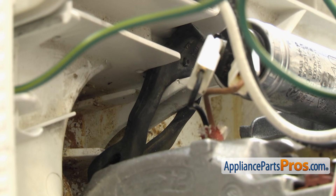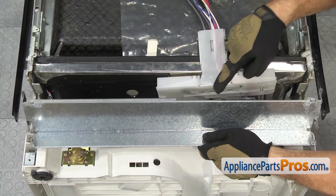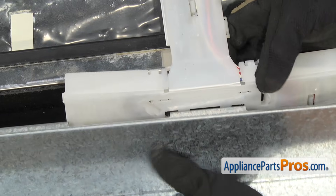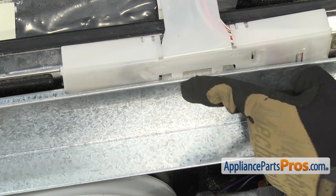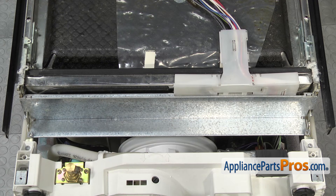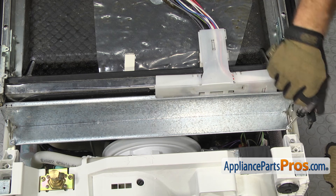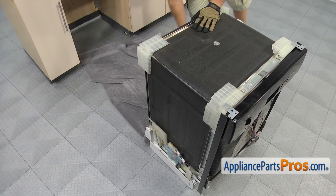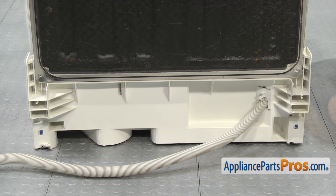Once you have that in place, we can go up top and put the support bracket across the front. To put the support bracket back on, we first snap the wiring harness cover into it — line it up and flex these locking tabs over so it locks into place. Then set it down so the locking tabs on the end of the support bracket hook over the frame. Once the support bracket is in place, use our Torx 20 driver to put the screws in. Now we can carefully lift the dishwasher back up and set it on its feet, pull the towel out, and then use our Phillips screwdriver to put in the two screws that hold the back to the base.